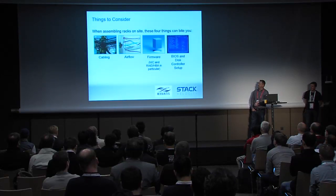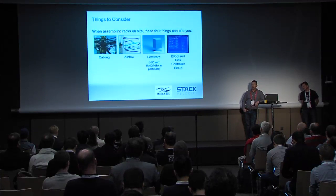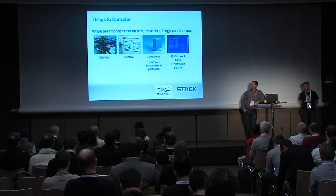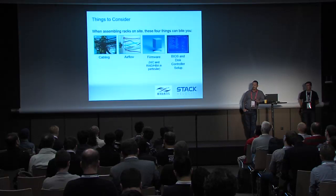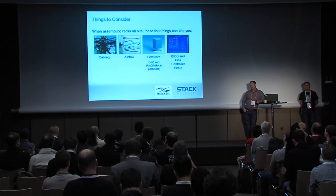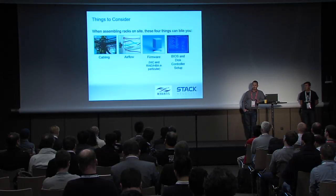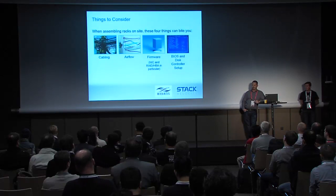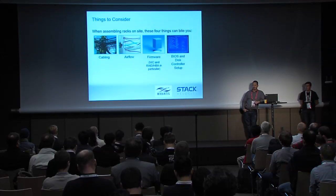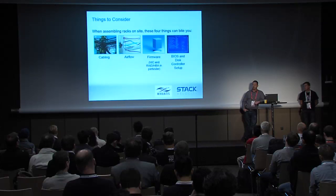Airflow is more important if you're looking at adopting white box technology versus OEM technology. OEMs have had a lot of time to plan, test, and build machines optimized for a wide variety of use cases. When you go to white box, you get all ends of the spectrum — some have spent a lot of time managing airflow, others haven't touched it at all. The takeaway: at minimum, on your first golden sample from a vendor, make sure you've got an air duct managing airflow to improve performance and cooling. Otherwise, you can leave a lot of money on the table, especially at the data center operations level.